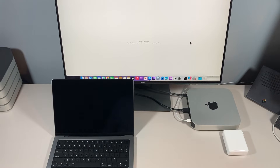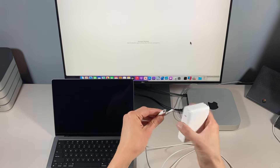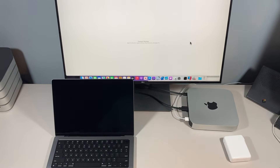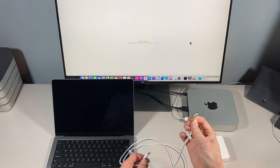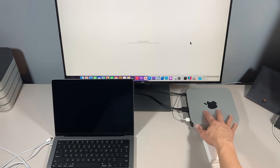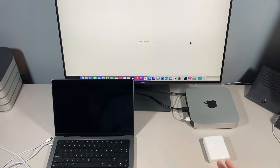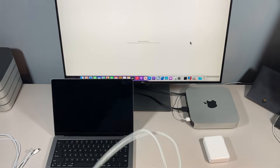The previous M1 Macs from 2020 had a charge cable that was USB-C on both ends, so you could plug it into the host Mac directly. But the new 2021 M1 MacBook Pro comes with a MagSafe charger — USB-C on one end to go into the power adapter and a MagSafe end to charge on the side. That becomes a real big problem because now you don't have a cable to use for DFU mode. If you have a Mac Mini at home, you're in trouble unless you have a USB-C or Thunderbolt cable. You can't do it with the MagSafe cord.